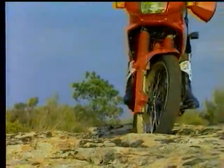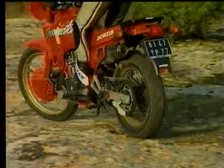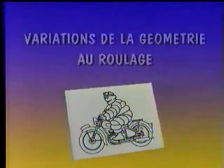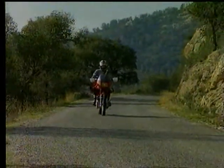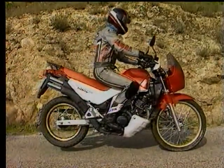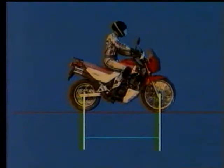The primary purpose of the suspension is — as a reminder — to keep the tires in perfect contact with the ground. The suspension must support the load and accept dynamic load variations without reaching the suspension stops — that is precisely the role of the spring. During braking, load transfers to the front, causing rear unloading and front dive. Because the front wheel axle cannot move vertically — being constrained by the fork's rake angle — when the motorcycle dips forward, there is a significant reduction in wheelbase, trail, and rake angle.